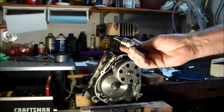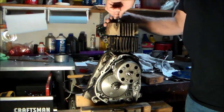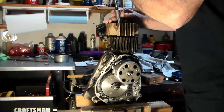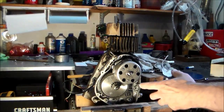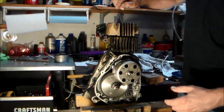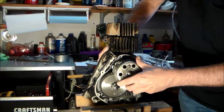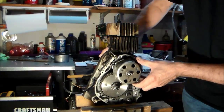Anyway, all you do is take this, stick it in the spark plug hole, and snug it. Then just take your engine and roll it over one way and it should hit this. We're going to go counterclockwise as we're looking at it — there, I just hit that. You can feel it's solid as a rock, so it's right there.